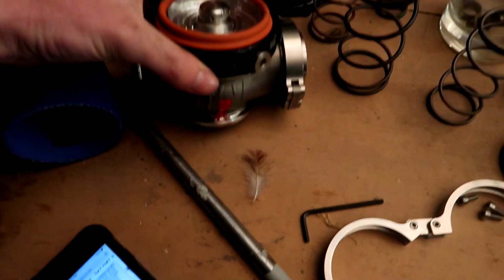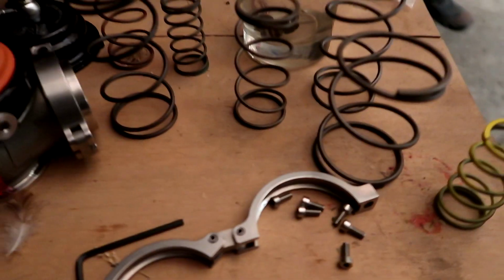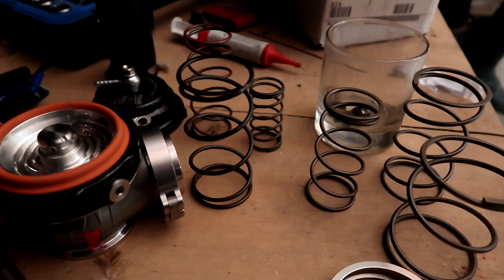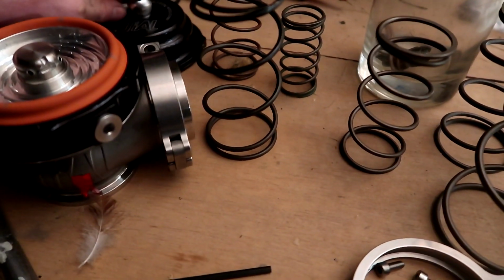So it's Monday night, it's dark out. Still at it. Josh is here, just bolting the manifold on for probably the final time, hopefully. So we got the wastegate here, it's an MVR, these are the new water-cooled ones, well not that new, but... So now we've got to set up the springs for this wastegate. Josh wants to run a low boost setting of about 13, 14.